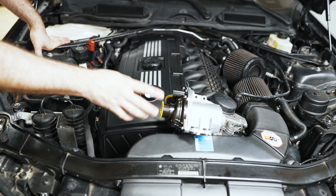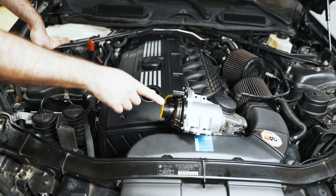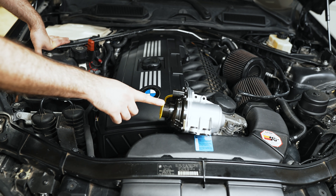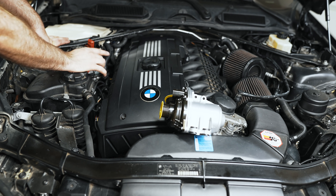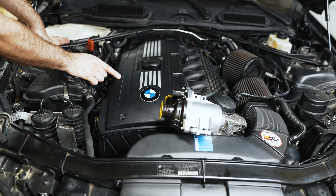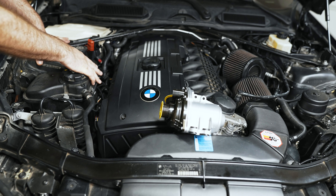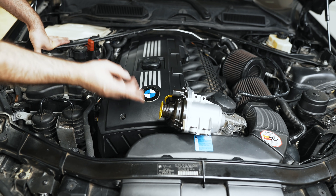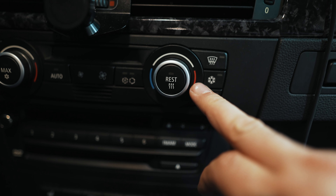There are still a number of advantages that make this more modern, even for a turbo car. One of the main ones: if you drive the car really hard and then come to a stop and have to shut it off, this pump can keep pumping fluid through the system to cool off your turbos even when the car is off. You'll hear it running if you drove the car hard, even as you walk away, pumping coolant through the turbos to keep them cool.